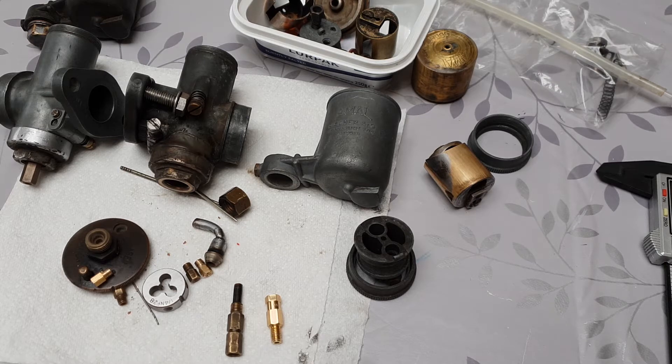The original one, up to probably about 5,000 bikes, was the M76 446 which was a 1-inch carb, 140 main jet, and a 6.4 slide. The more common ones you find are the M76 451, which is 24 millimetre — about 15/16 inch — with a 115 jet compared to the 140 of the 446 version, a number two needle clip, and a 6.3 slide.